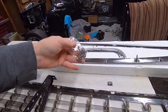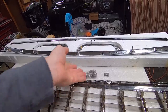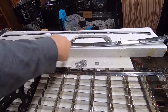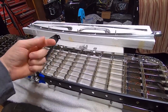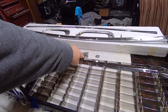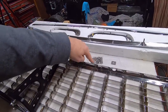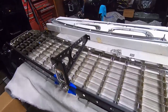I've got stainless steel regular nuts, lock washers, and flat washers, and I buffed all of those on my polishing wheel as well — that was not fun and a lot of mess. What I ended up doing was taking a piece of stainless steel all-thread, putting everything loosely on it, putting welding gloves on, and holding each end so the nuts and washers wouldn't fly off while running it on the buffer. The buffering wheel would spin the stuff but it polished it too. When I first started I was trying to hold each piece by hand and you just can't — they fly out of your hand and get so hot you can't hold on.